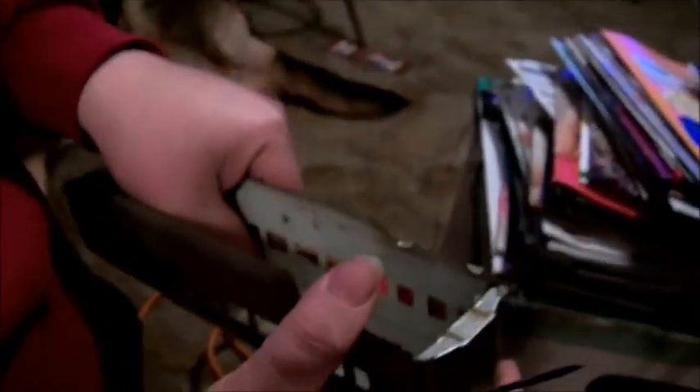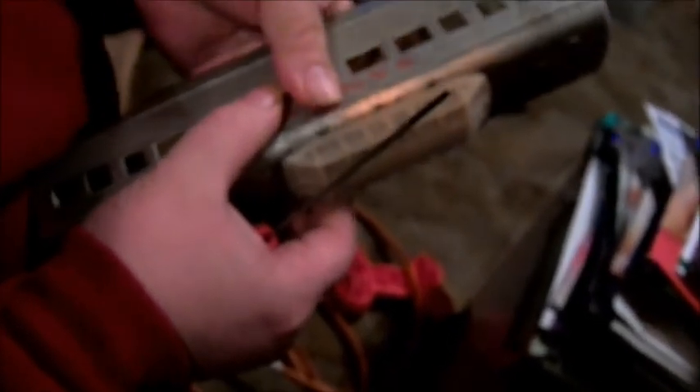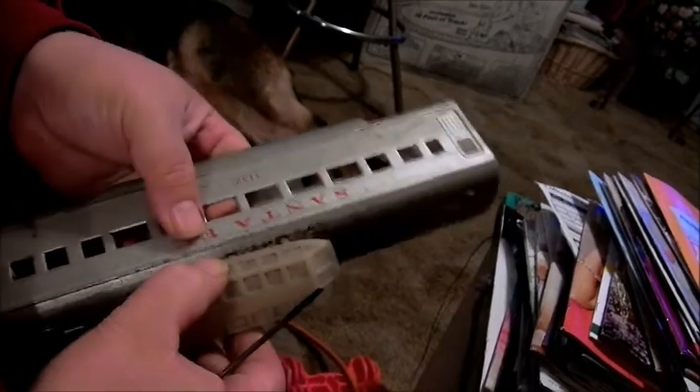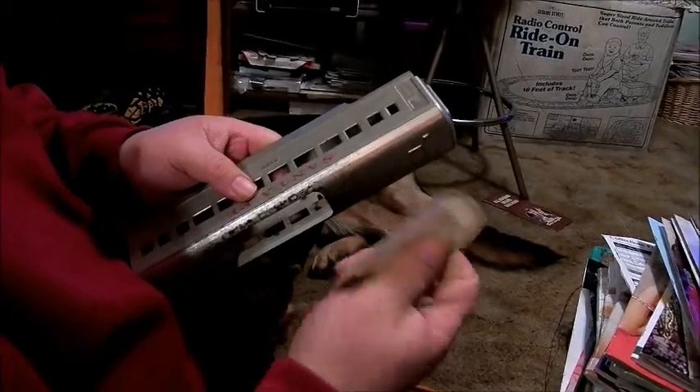Once they're pretty well straightened, try to apply a little pressure to the peg to see if the dome will start to loosen. If you notice it's starting to pop up a little bit, get a screwdriver and very gently work it underneath. Pop it up on one side first, then come over and gently push the peg on the bottom and just gently pop them out — and there they are, all six. You haven't lost a one yet.